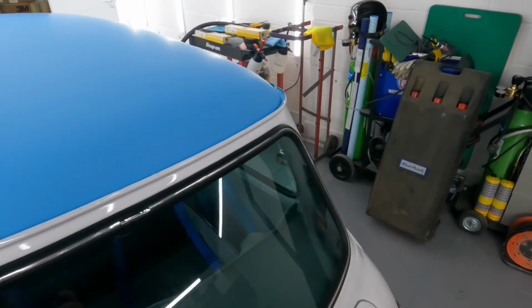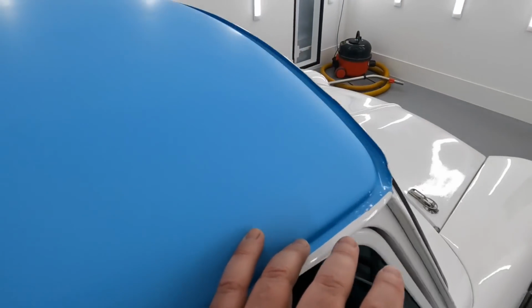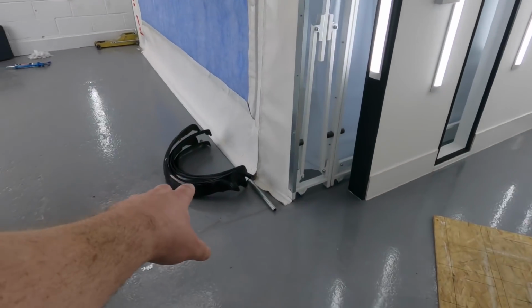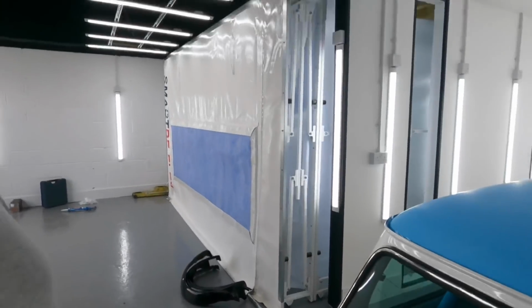I've still got to tackle all the channels. I'm going to do that by hand. That's probably going to be done in the morning. Arches have been ripped off, they're over there now, so I can crack on with them. So yeah, we'll do all this bit by hand, sort all the channels out, and fix the seam sealer that's split around here, and a little bit at the front, and we'll get this in primer. And also, in between, we'll sort this out, sand them back, try and chase all the micro blisters out of that, and get them in primer. So I shall see you in the morning, which will be in about a second for you.